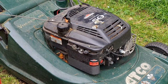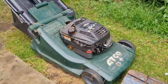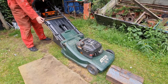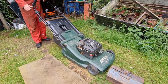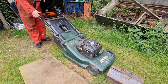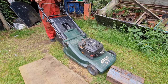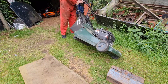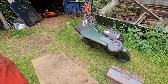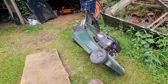Best thing to do to avoid that — we're going to do the whole tip it on its side thing. Get your mower, pull your dead man, and just pull the engine over till that's on compression. There, we're on compression. Now we know both valves are shut. No oil can now get through. So now we can tip the mower slightly on its side and the petrol won't leak out of the pipe. Top tip: make sure it's on compression.